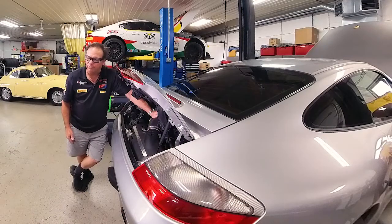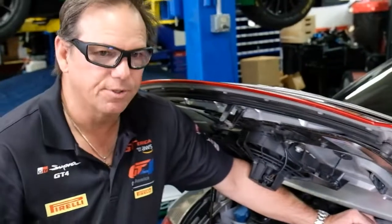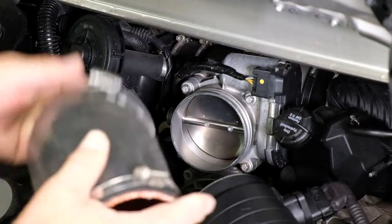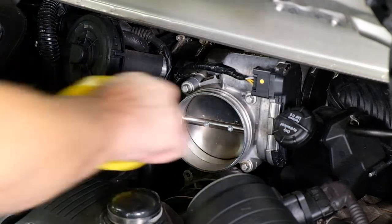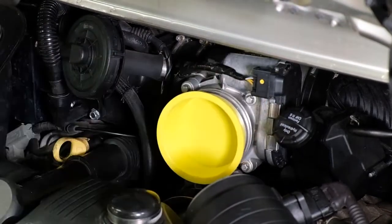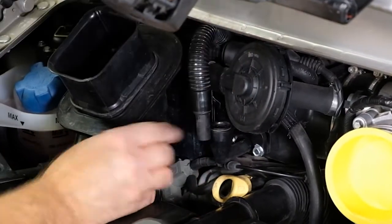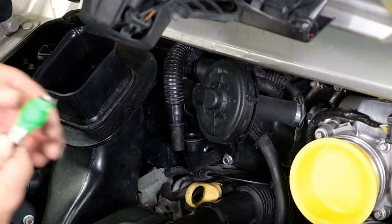A false air leak can actually give you a vacuum leak reading. So be careful of both false air leaks and vacuum leaks, and you want to check it when the engine is cold. First, obtain a smoke tester. Take out your intake boot — we've already loosened these clamps — and you want to plug off the throttle body like that. Then slip this pipe connection off the brake booster area.